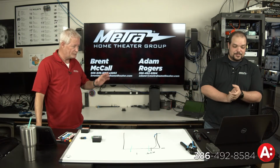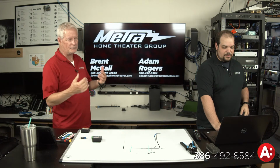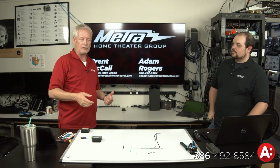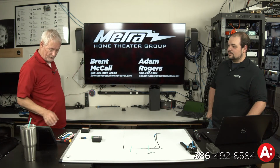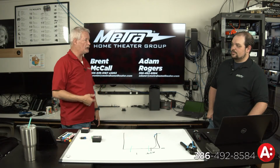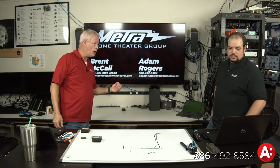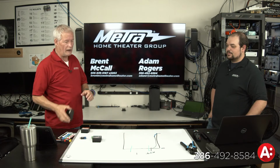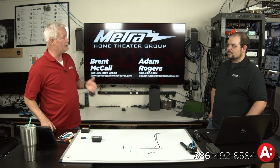So we have talked about rise time issues and basic troubleshooting. The very first thing we do is have a source that is not the customer's. Make sure that the input to the TV is working. If it is not, now we have to do a little bit more work, because we plugged our source into the cable and we get no picture. Now we've actually got to go to the TV and get behind it, because we need to take the source directly, with the cable that you have in your truck, that you've tested, to try that input. Does that input work? If that input works, now we start going backwards.